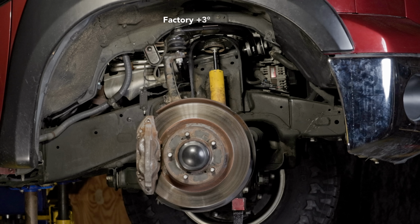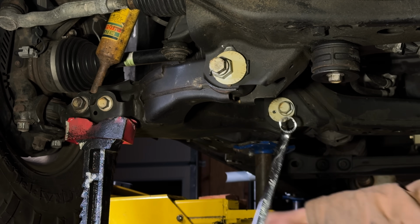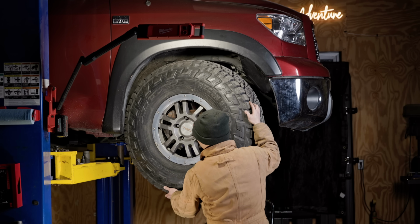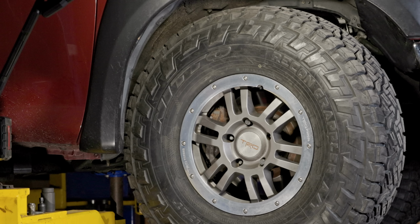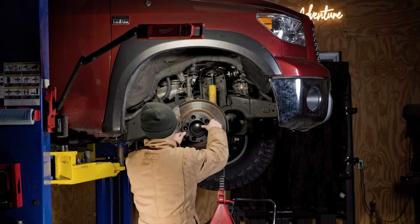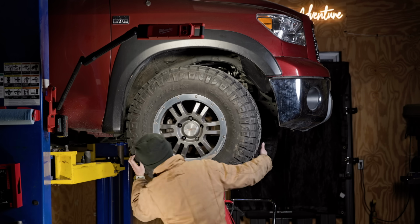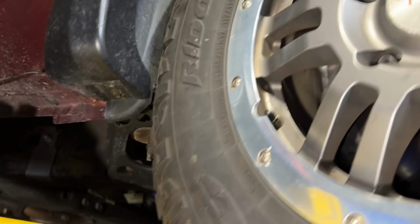If you only have about a 2.5 inch lift, running a UCA like that will result in too much overall caster. So during a wheel alignment, the lower control arm will actually need to be adjusted backwards to bring the caster angle back down. As you can see, this sends the 37 straight into the wheel well, a huge difference from our previous setting. And all we changed is the alignment. Now, if we throw in 0 offset wheels on top of a bad alignment, we can actually make 34-inch tires rub very badly. But this is exactly what's happening on many trucks out there.